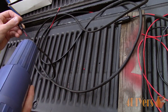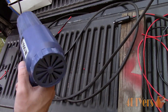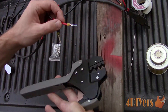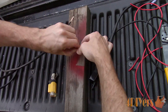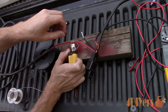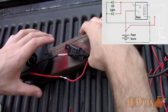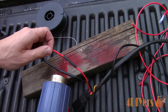Add a connector to one side and the other side will need to be soldered. The wiring kit did have some wires cut off, so I will need to add those back in. I have the relay with the pigtails from the connector and the only wires I do not need to run are from the switch. This switch can be mounted anywhere. You will need to pick up something where the contacts are hidden so they cannot short out. This will remain a switched power supply and the switch also has illuminated LEDs. Soldering the supply wires to the relay — for me this part will remain inside the vehicle, so there isn't a need to use adhesive filled shrink tube. Ensure the relay you are using is able to handle the amperage of the lights, as relays do come in various amperage ratings.